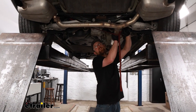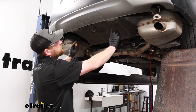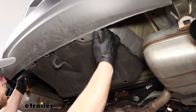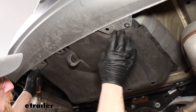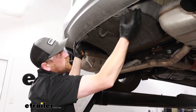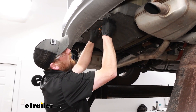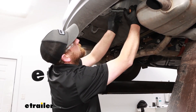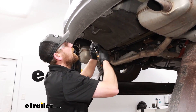If you look at the bottom edge of your fascia, there are going to be a couple of pushpin fasteners that we need to pull out. It seems like some CR-Vs are set up differently — we have two, others might have more. Regardless, you need to pull those out. To do that, take a flathead screwdriver and just pry underneath the head of it. Sometimes these get sticky from dirt getting in there, so just take your time and work them out.